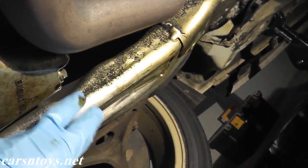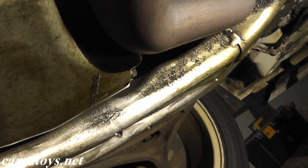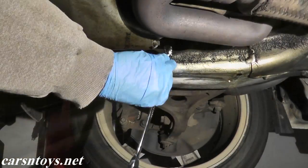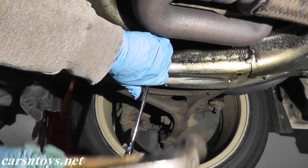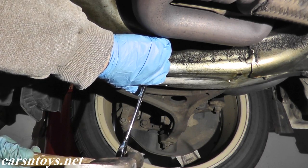So let's go ahead and drain the oil. You'll also need an oil pan. We'll change the oil filter and we'll be in good shape. Now if this bolt is a little too tight and you can't remove it, get yourself a carpenter's hammer and just tap the wrench and it will come loose very, very quickly.